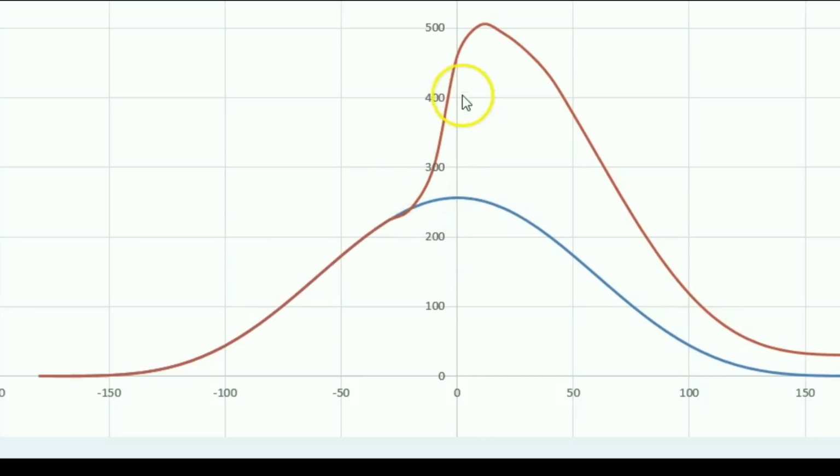The point here is that this is what the pressure will look like once you fire the spark plug. So let's say the spark plug fires somewhere over here. Then when the air-fuel mixture ignites, it causes this whole bunch of extra pressure on this end. And this extra pressure, this difference in pressure, is what gives your engine power. This is what will give your engine the torque output it's giving you. And this tiny part over here is the part where you're actually pushing the piston backwards. And this is actually something that makes the engine inefficient, and it's making you lose power.